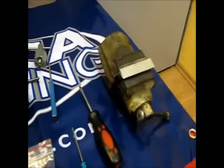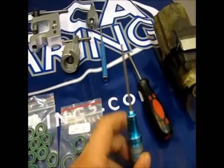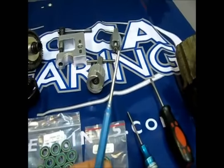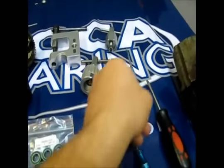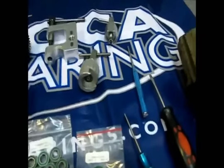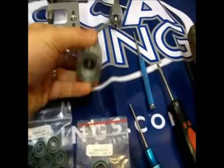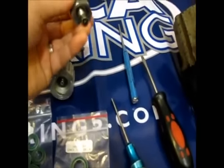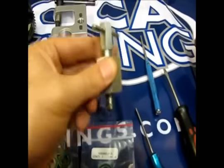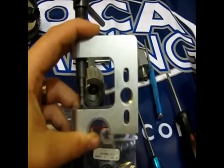From tools, you will need a small table vise, flat screwdriver, Allen head 2.5mm, and a steel tip to push out the bearings. If you want to keep your bearings after removal, you need a removal tool which won't damage the bearings. Here is the diff removal tool which is widely available, and also the 10mm inside diameter bearing removal tool. And here is the FG mounting device which we will use to mount the bearings.